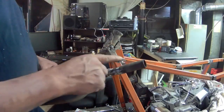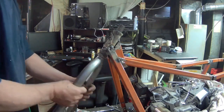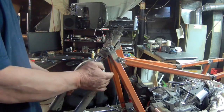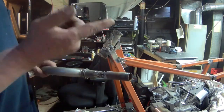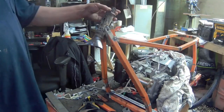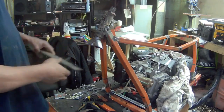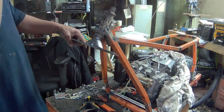So here's what I did: I extended the neck so it gives me enough room to put a plate up here, plus the nuts and the bearings. I'll cut this here, put a plate here and a plate here, and then the forks. It came out good — it might not look the sexiest or the prettiest, but it still turns me on. The neck extension I put here works out perfect. I can make a plate up here for the handlebars, and I ended up cutting the forks here, which I can also make a plate for now.